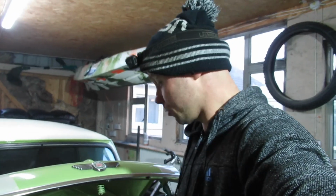I still probably have to buy a new fuel pump and put it on. I don't know why this one broke. I think, maybe I'm wrong, but I'll just check and see at home. I think it's supposed to be a little bit of spacer between that pump and engine block. Mine doesn't have one, and I think the camshaft is pushing that pump too much, and that's when it broke. I don't know, maybe I'm wrong. Maybe the pump was just weak.